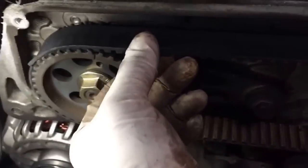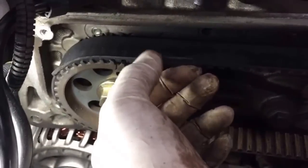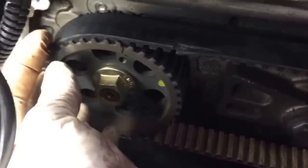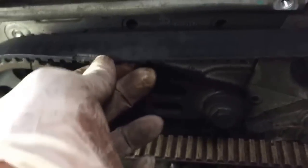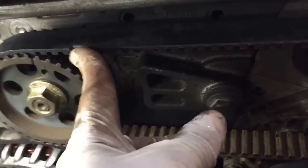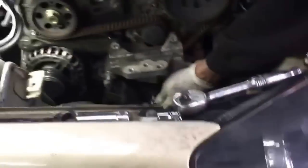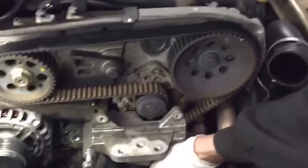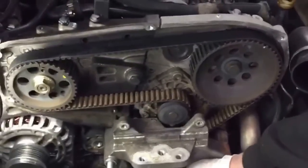Now that's dangerous. What you've got to remember is if this belt breaks, it'll mess your engine up completely — so you'd be looking at rebuilding the engine, which I don't think you want to do. So replace the belt, replace the water pump and off you go. Everything is as normal as it was, and you wouldn't have to worry about damaging the engine.